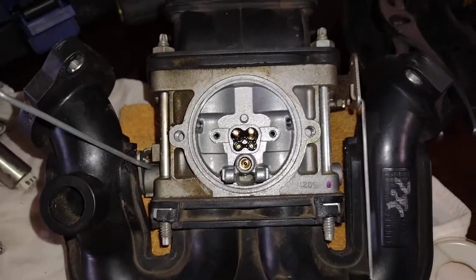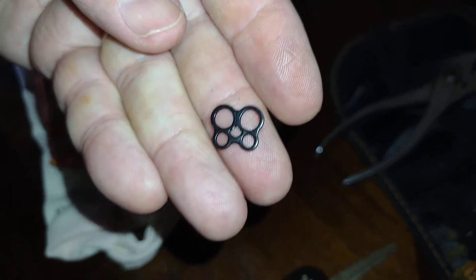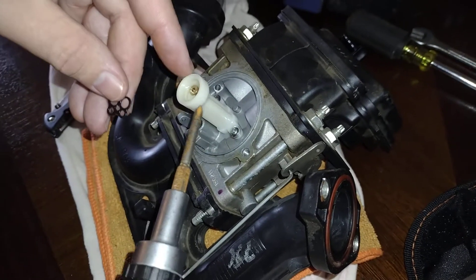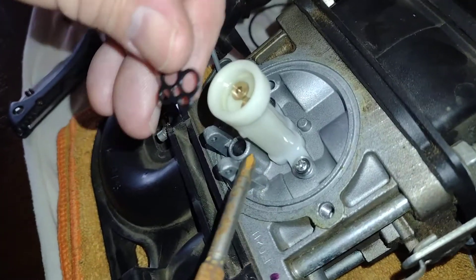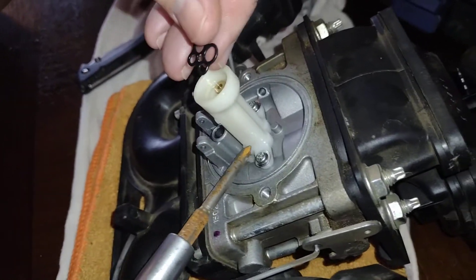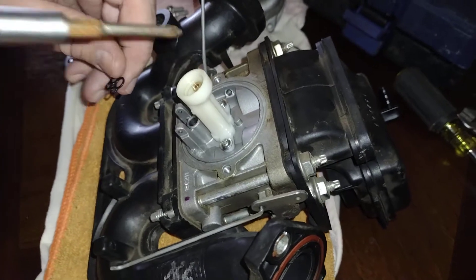The little butterfly gasket — here's the old one compared to the new one. The side profile from being smashed all that time was much thinner. What I tried to do is seat it up on the shaft for the jets and then place it down on there, because when you just lay it down it kind of falls because the circumferences here are larger than the fuel rails. There are two of them on either side. I set it down carefully and made sure the gasket was seated up underneath the plastic — there's a ridge all the way around inside. I made sure of that, then started the screws in.